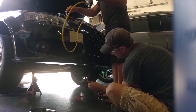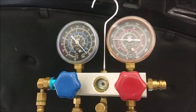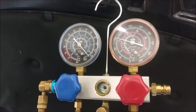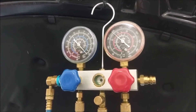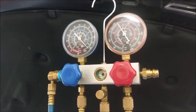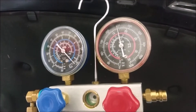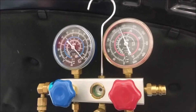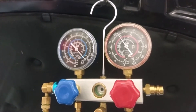The other one's only 55, 56. You've got to monitor your high side while doing this manually and cut it out yourself — I'm doing it around 250 psi. The little box fan I've got is not going to push a lot of subcooling so eventually it's going to creep up. The low side's not connected right now because we just got done injecting oil. At about 250 you want to disconnect, and then the pressure will start dropping when you disconnect the wire. That's how you override these variable compressors so you can fill them with oil and refrigerant without special tools and computers.